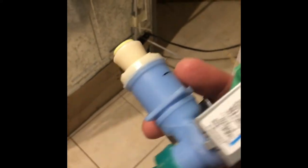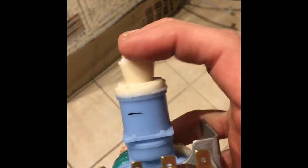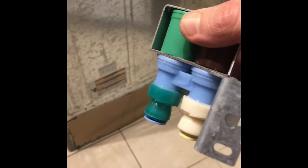The back's back on, thing's screwed in right, water is filling, and there's not a huge water leak everywhere. Just to go over — this is the water inlet valve I replaced. As you can see, there are cracks all over. We bought it off Facebook Marketplace. On these ends where the tubes go in, you depress them and push them in — that's how the tube comes out. Pretty easy to remove, pretty intuitive. Hopefully this helps somebody else out if you have a floor full of water.